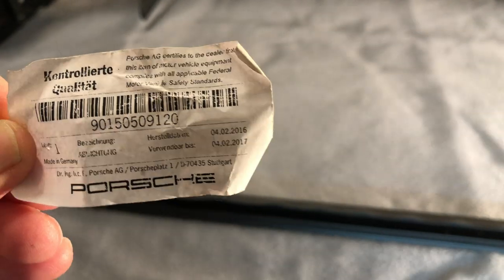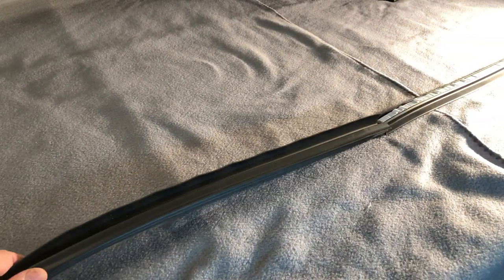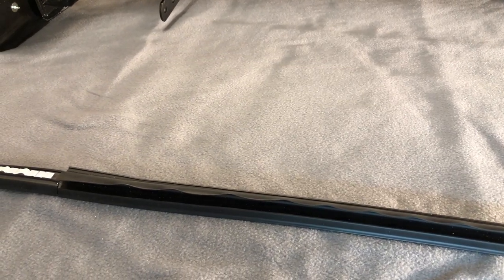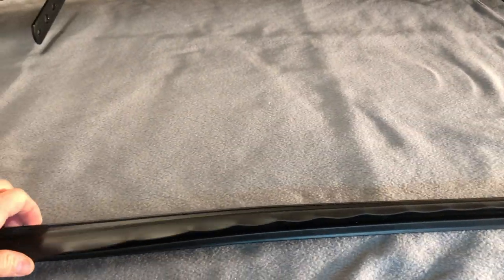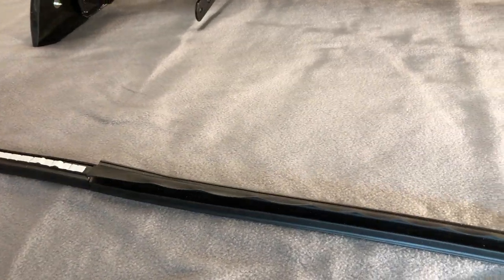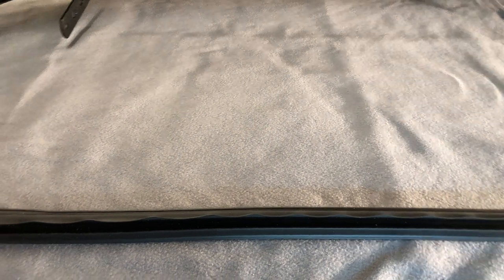Having a look at our front bumper seal — this is a part number from Porsche. How this one works, it's actually glued together, two different profile-type molding. The right side is already falling apart — it's just glued together. I think it's going to serve our best interest to separate this now and go ahead and install the centerpiece, which is a completely different profile than our fender pieces. But this one definitely needs to be put in place before we install the bumper. Let's go ahead and separate that and get it installed first.